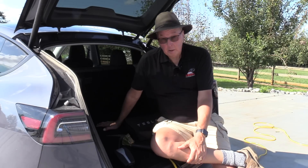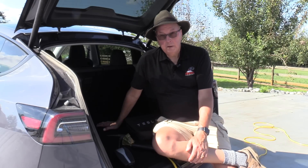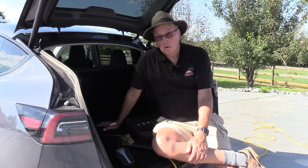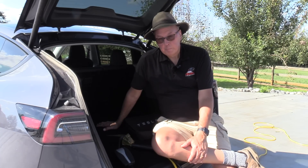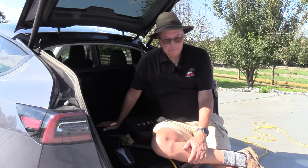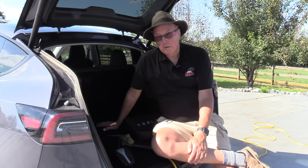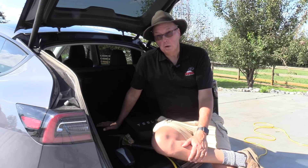It's hot today — better part of 90 degrees. So, the 75 feet of number 14 extension cord was able to charge the car at 12 amps. Any more than that, we found that the voltage would drop and the car would reduce its charge current, which directly affects how many miles per hour of charge. With the number 12 extension — which is about 30% larger than number 14 — we were able to do 125 feet and charge okay.